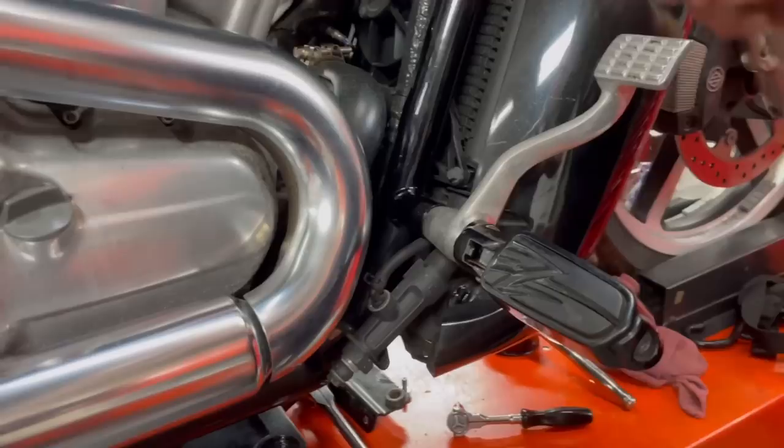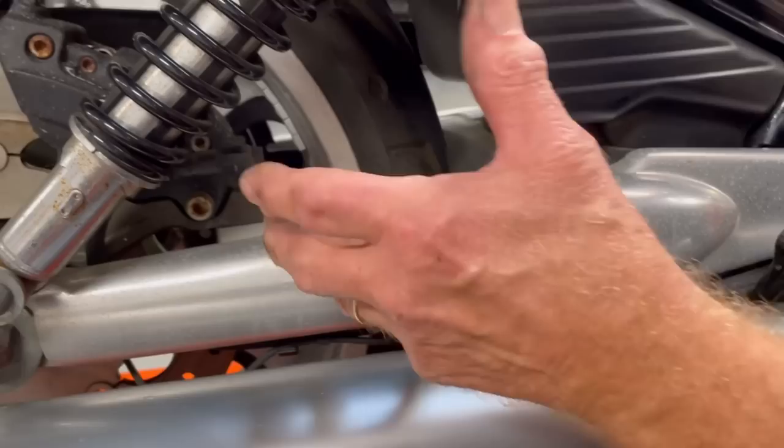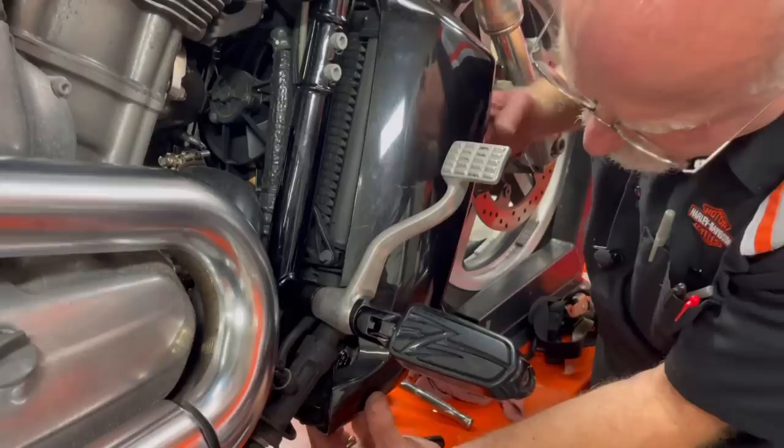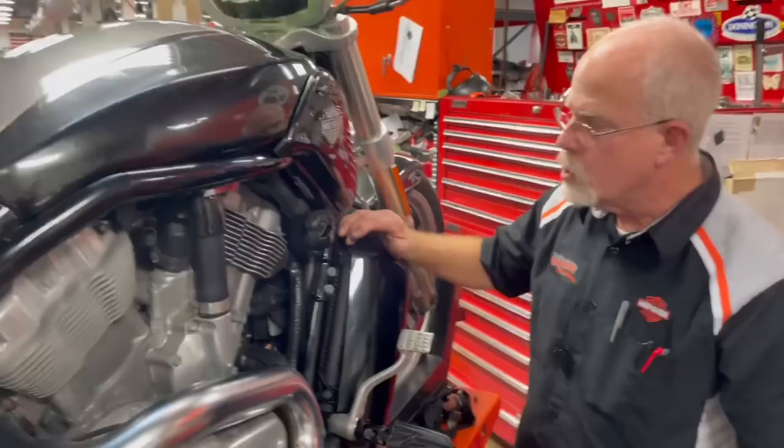Let's go down to the brake pedal — wait a minute, I don't see a reservoir. I've got a pedal and a master cylinder plunger, but let's follow the brake line all the way back — there's no reservoir there. How can I check the brake fluid level? We come back to this area, and if you have a four millimeter allen, there's a small button head allen underneath this plastic. Take it out, pull down and out, and look — there is the master cylinder reservoir, so you can check the level and the moisture content on it.